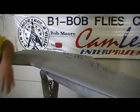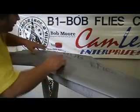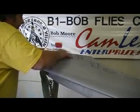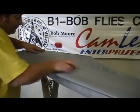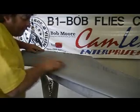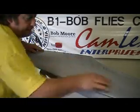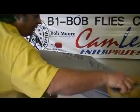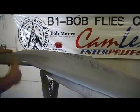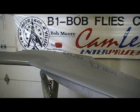All that can be sanded out, I believe. This spot here might need a little bit of filler. If you guys ain't ever tried this guide coating and you want a super nice paint job, try it. Just when you think you got your primer ready to paint, hit it with the guide coat, lightly sand it, and every little spot — bam! — will jump out at you. Every little one.